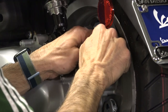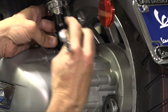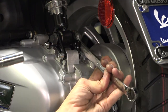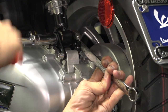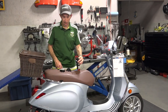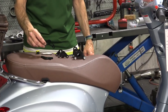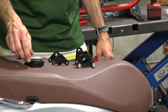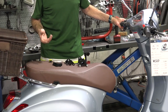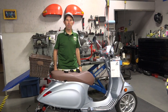Take your 17mm combination wrench and put it on the nut — it's easier to use the open end — then get your ratchet on the bolt and tighten up the lower shock mount. Thanks for watching. As you can see, there are various options: from the stock bracket, to the standard steel lowering bracket we've had at ScooterWest for years, to the newly engineered all-aluminum racing-style lowering brackets. Search for lowering brackets or the part number on the website — you can also find part numbers in the video description. This is Robot from Vespa Motorsport and ScooterWest here in San Diego, California. See you on the next one.